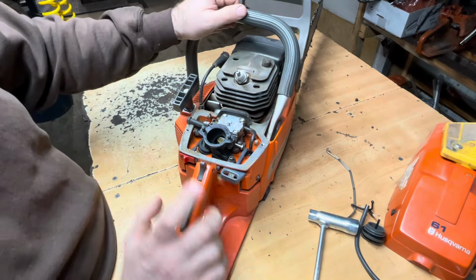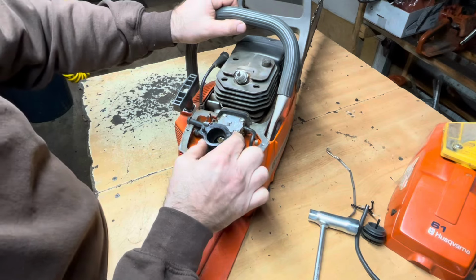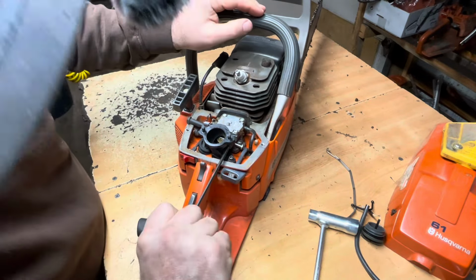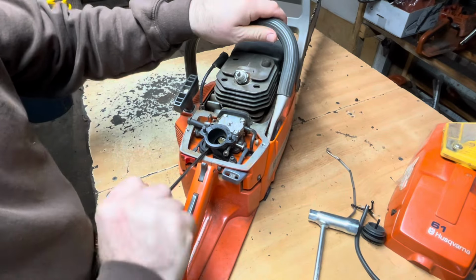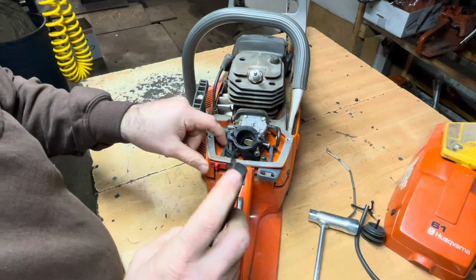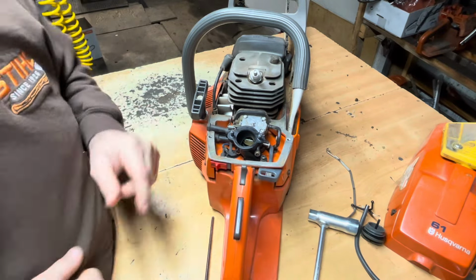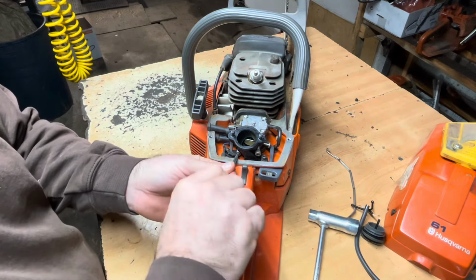Okay. Actually, I think the pump side is up here. So I'm just gonna take this. I don't think it'll clear. That screw won't clear. I'm just gonna pull that top cover off. I think these are 4 millimeter. Those are. That one's always a little harder to get to, if I remember right. Like little grommet. It's not around the throttle properly. Okay, I'll address that. Almost need a little ball-ended 4mm to get this side out. That's why I have this. I don't see this model very often.